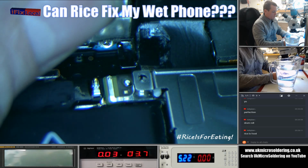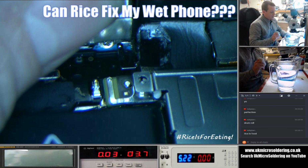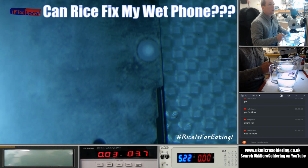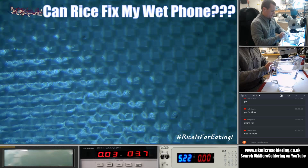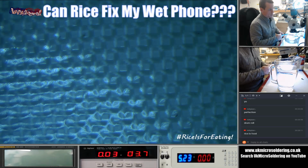And then we've got a little dude in there. So this dude has never seen any water. They're moisture controlled. You can lick them, they'll go red. That tells you that moisture has been in the phone. And just for good measure, there's one on the back of the screen. So a pretty good indication that I'd say that this phone has never seen water, as most phones shouldn't. So let's close this back up. Let's see it working.